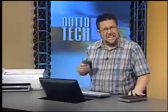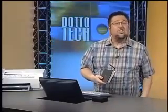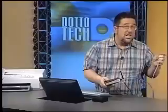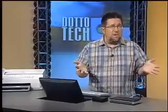Now, connecting and configuring a Wi-Fi network today is a lot easier than it was a few years ago. In fact, you can probably just plug in a wireless router and it's going to start to work automatically. However, I want to show you how to properly configure it with security in mind. And this is becoming an increasingly important consideration because a wireless network has a range of up to about 100 meters. So if you have one running in your home, chances are it's going to reach a sizable part of your neighborhood. If you leave this network wide open, that is, if you don't encrypt and password protect it, anyone within range can use your connection.